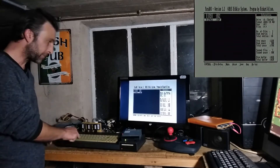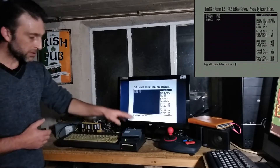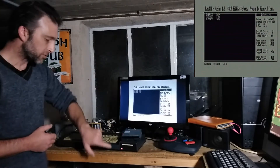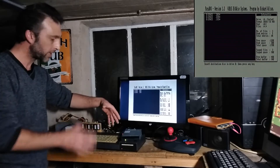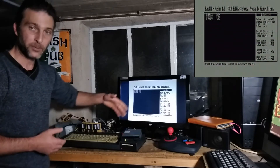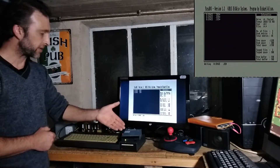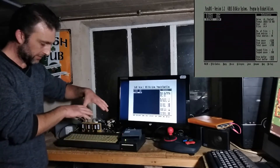Now I've tagged all three files. To copy them I press Ctrl and C. It asks which drive to copy all tagged files to, so I press B — that's where I have my three and a half inch disk inserted. It starts reading from drive A; you can see the free buffer diminishing as the computer's memory fills with the contents of drive A. It then asks me to insert the destination disk into drive B and press any key.